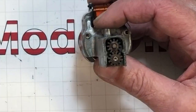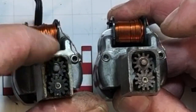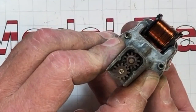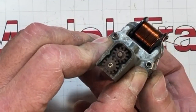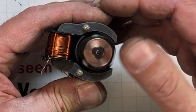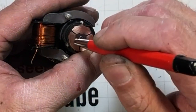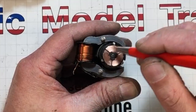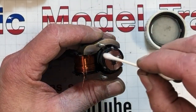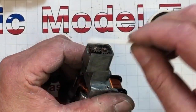I had to put it in for about seven minutes, scrape it out — it came out like mud stuck on the end of a toothbrush, just packed in so bad. Put it back in to do it again until I finally got it super clean. Here's the clean one, and here's the one I haven't done anything with at all. The cleaning did a lot of good — I can take the armature and it just spins like a dream. I cleaned the commutator off with one of these little fellas, and some q-tips with odorless mineral spirits to clean up everything in this area.